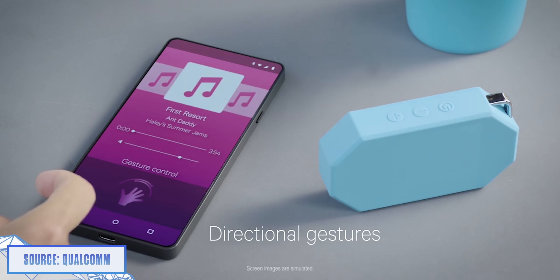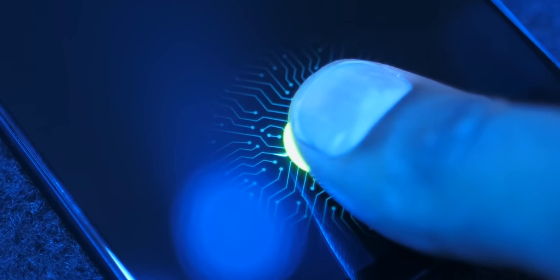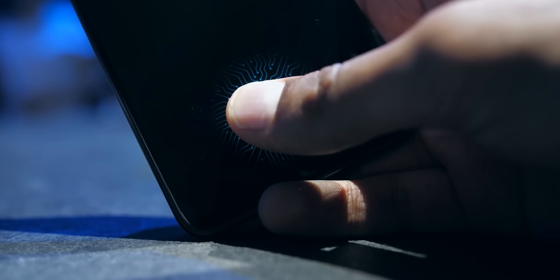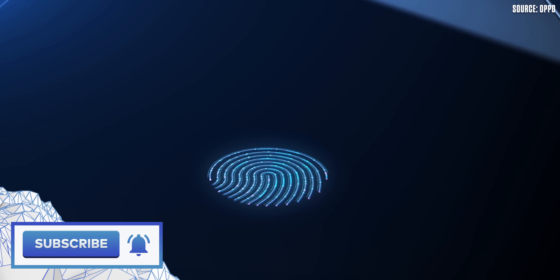And this is only the current generation of scanners — there's quite a big future here. The potential exists to detect what is happening not just on your finger, but also up to 4mm behind it, meaning it could detect your blood flow or heart rate in an instant. Also, since the tech sits behind your screen and doesn't need the screen to be on to power it, it can save a lot of battery. With an optical scanner, the finger has to be brightly lit, and considering the average person unlocks their phone 200 times a day, it all adds up. I'm also excited for larger fingerprint scanners — this tech can be easily scaled, so the idea of an all-screen 3D Sonic Sensor is not an impossibility.